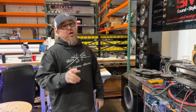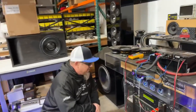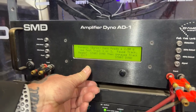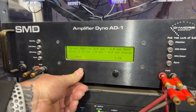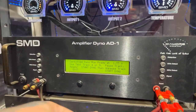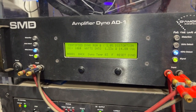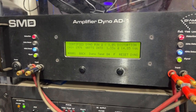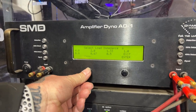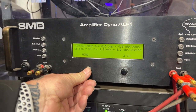I don't know if I should drop this thing down to one ohm, but we'll try 1.33 ohms and see what happens. It might go into protect, and if it does you can't blame Audio Control — blame me. So let's do 1.33, drop it down just a little and see what happens. Certified mono next at 1.33. We'll start and here we go — oh! 1976 certified! Yeah, all right. That was at one percent distortion, so that's pretty nice.